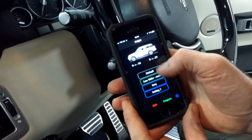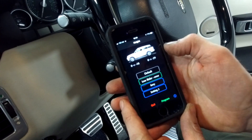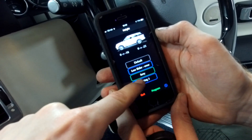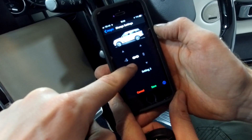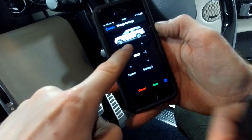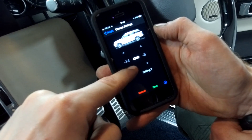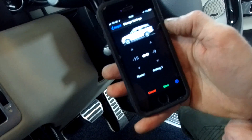I think that was as low as we could possibly go with the settings. If you hold down on the profile you can adjust up or down — they're locked at the moment, so whatever we do to one side it does to the other, which should keep the car level. We're going to go for minus 15 on the front and minus 9 on the rear. Should we save that? Yeah, save that.